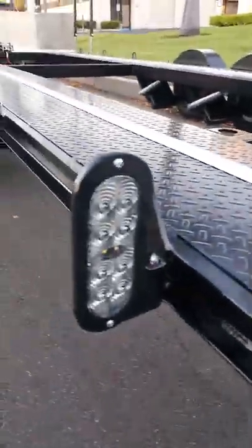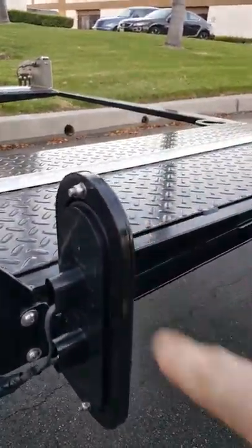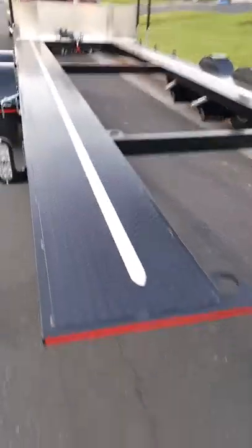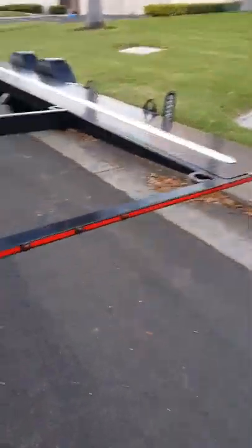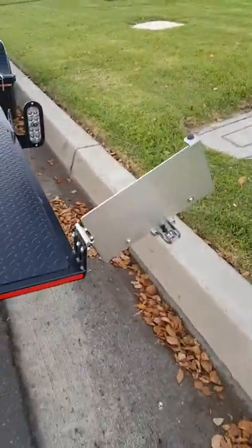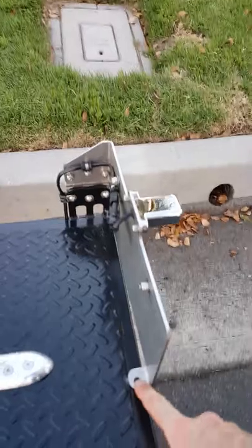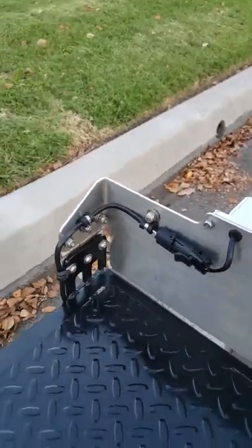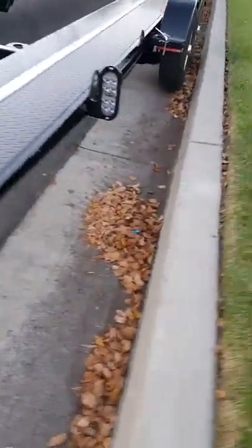Techniq lights all around — a really nice, made-in-the-USA product. These are their new tail lights that we're running. We made our own brackets — laser-cut and CNC-folded — and they fit the lights perfectly. They're a really nice tail light and they've got a reverse light in them now as well, which is a new feature for this year. We're also trialing a new rear reflective strip. You've got three central lights at the back, and when loading the trailer the license plate just flips out of the way. It's all stainless steel — rubber boot so it doesn't make noise, all weather-pack connectors, stainless clips, stainless fasteners, stainless hinge. Generally they only need replacing if someone drives into the back of you.